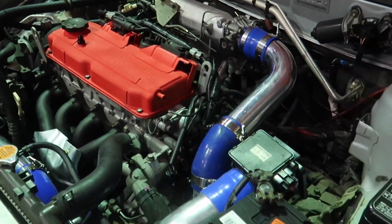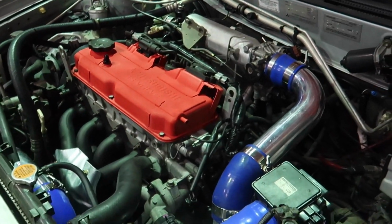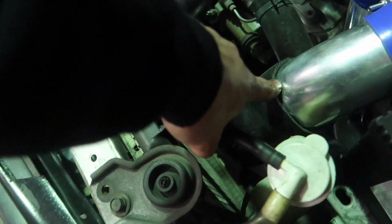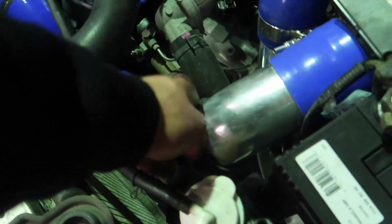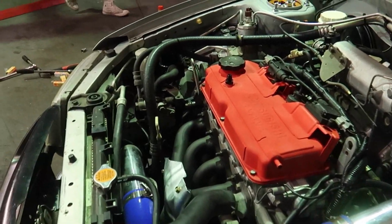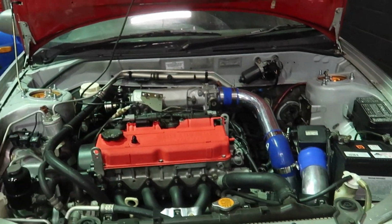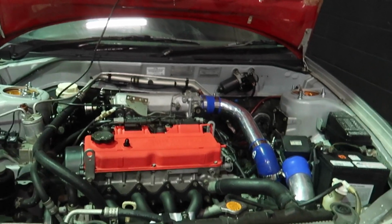One thing I must say is, obviously the engine's not tuned for boost, so it's not going to absolutely rip right now. Also, our intake pipe doesn't even have the hose clamps on it, so that'll be taking in unmetered air at times, especially under boost. But we know the system works, which is fantastic. Now it's just about refining it before we take it for a tune.